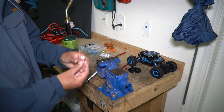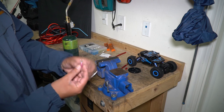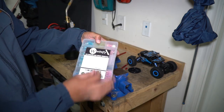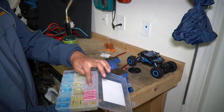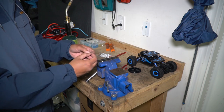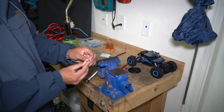The next thing you're going to need is this spade terminal I mentioned earlier. This is for 16 to 22 gauge wire — you can see my fuse block has plenty of these. I just buy one of these kits on Amazon from Wirefy — I'll leave a link for you guys. These are heat shrinkable as well, so once you crimp the wire in here you just heat it up with a heat gun, not a torch, and it gives you a nice connection. You can bend these as well to get yourself a nice clean look.